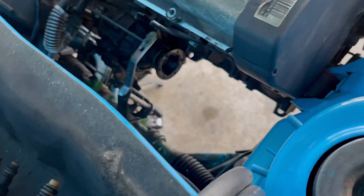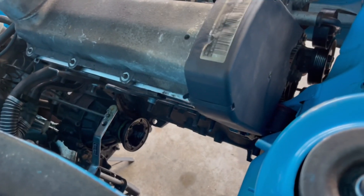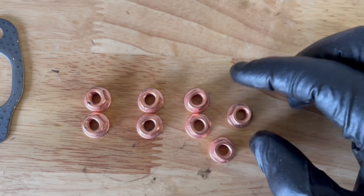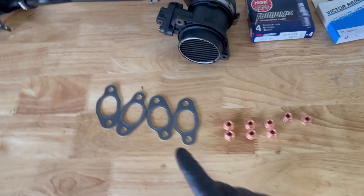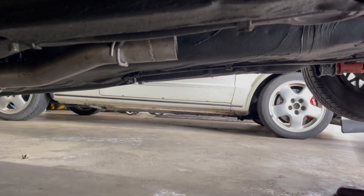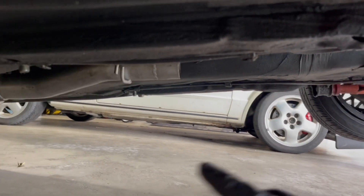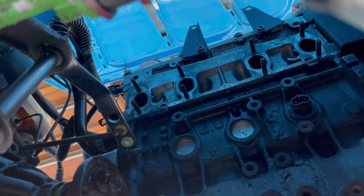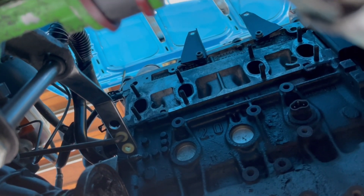Driveshaft's out and hopefully that's enough room. The second coat's on the header — we're just going to let that dry for about 45 minutes to an hour, and then we should be able to put it in. You can see the studs are in. Always want to get new nuts every single time because these copper nuts are used once — as you can see, they're a little bit oblong. So I've got new nuts, new gaskets — go ahead and throw that in, and then we've got to figure out how we're going to tie it into the exhaust system. Since this exhaust system is also TT, it should mate up pretty quickly.